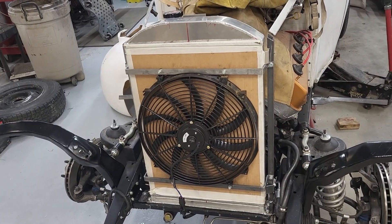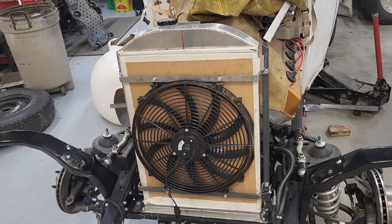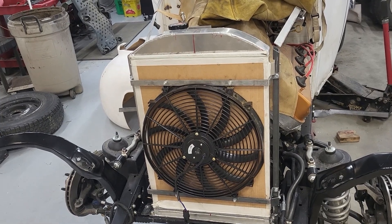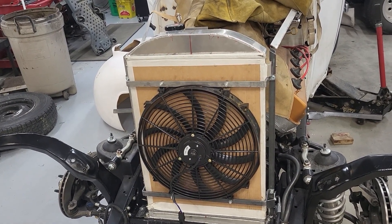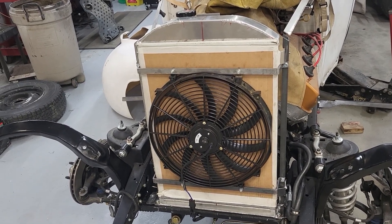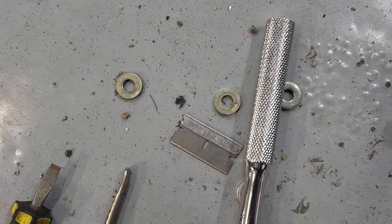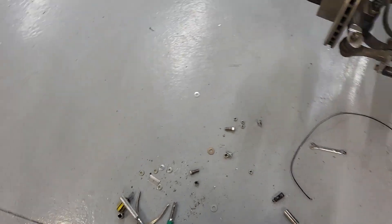When you buy a washer at the hardware store — a general grade-5 or grade-2 washer for a quarter-inch bolt — it has a 5/16ths hole and they're sloppy. The nice thing is they're all one bolt size larger. If you want a tighter-tolerance washer for a quarter-inch bolt, buy some 3/16ths washers because they'll have a quarter-inch hole and they fit on perfectly. There are SAE applications and washer grades that change that, but generally for fab work, if you want a good finished look, I get SAE washers — for a quarter-inch bolt that's a grade-8 SAE.